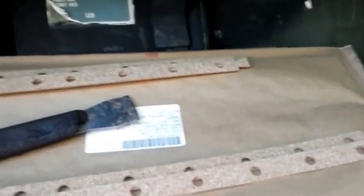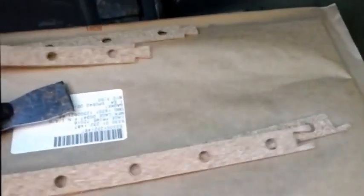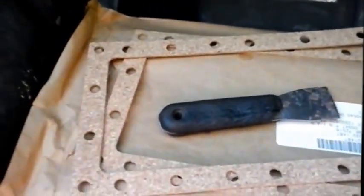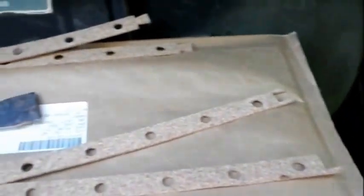What we've got over here is our tank. We've got the surface of the tank cleaned up. We're using our two-piece gaskets here — as you can see, they kind of interlock together like a puzzle. We're gonna use a little bit of silicone, maybe some spray tack on there. And when we tighten them down — because I could never find any torque specs for this — I'm gonna tighten them down just like I would on a transmission pan. You'll just run them until you see it start to squish and then you better stop.